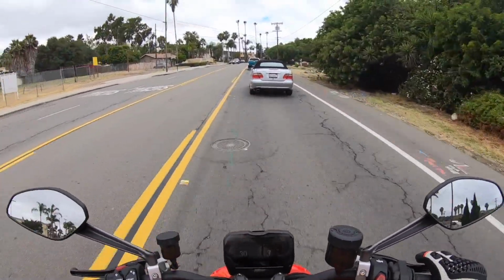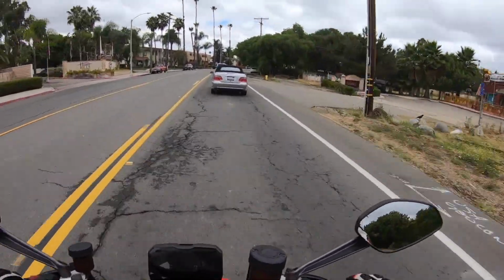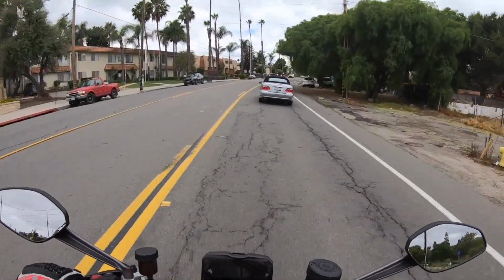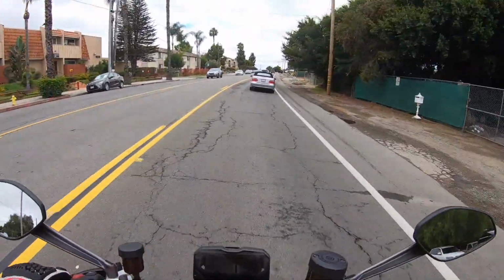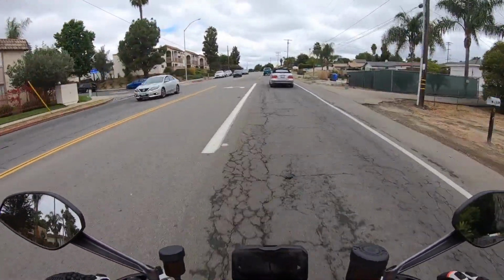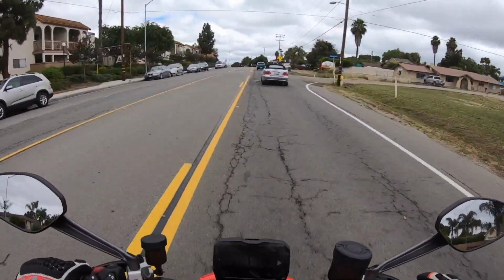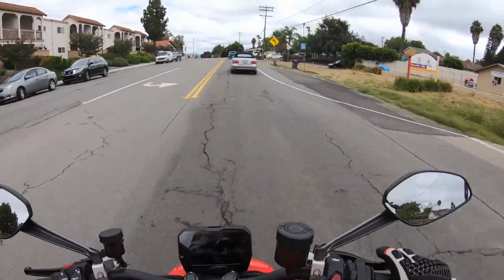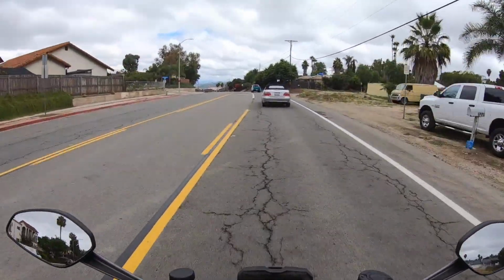Suspension. This motorcycle is set up with Ducati's DES suspension, Ducati Electronic Suspension. It's a semi-active suspension control in which the computer automatically adjusts in real time the compression and rebound damping circuits of the fork and shock based on control input, i.e. brake input and throttle input, and vehicle conditions.